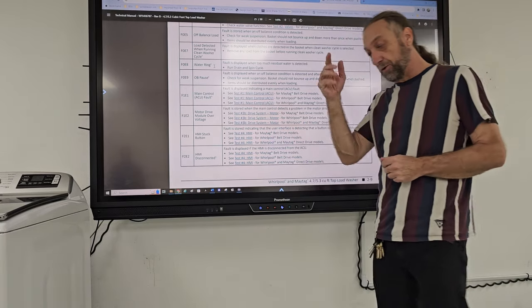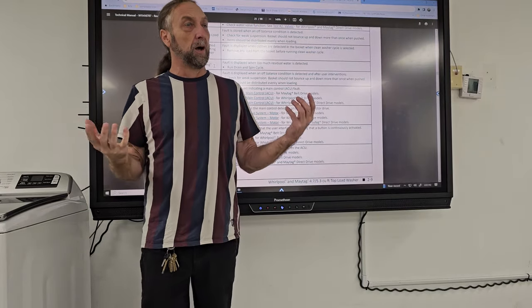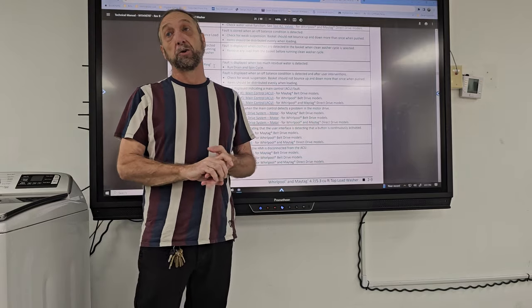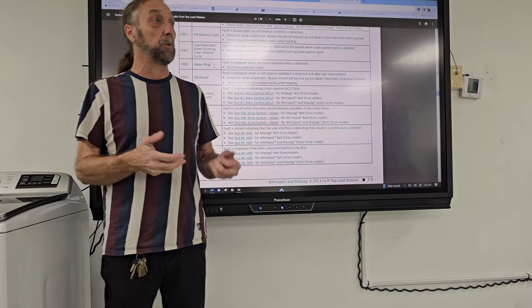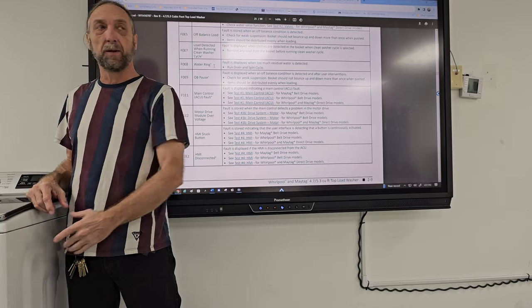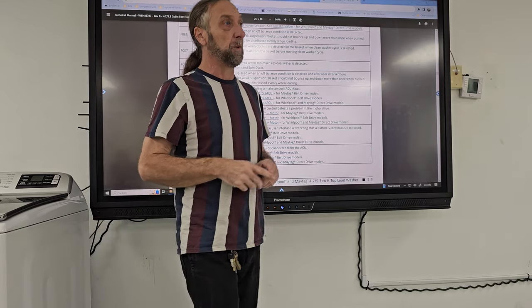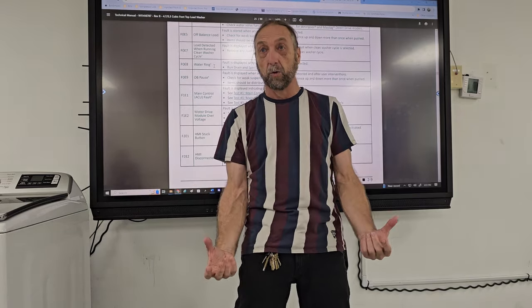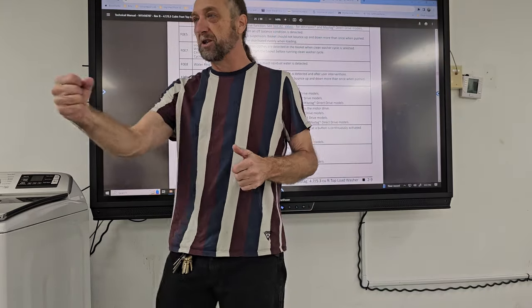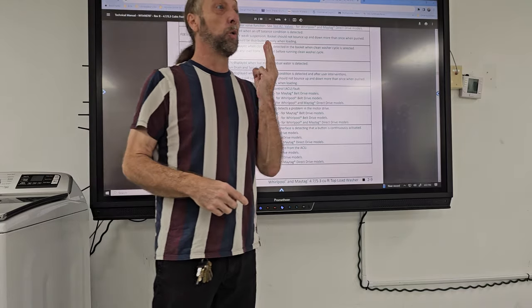I'll give you an example. A former student of mine, who lived down the street from me, called me just the other day and said her washing machine was banging all around. I told her usually the suspension or the shocks need to be replaced. I thought it was a top loader like this, but it happened to be a front load washing machine. She had four little shocks in a box, and luckily it was one of the older Whirlpool kinds, so you could just remove the lower panel and the shocks are right there. You didn't have to take the machine all apart. Within 5 minutes, I found that three of the four shocks in that washer were completely broken.